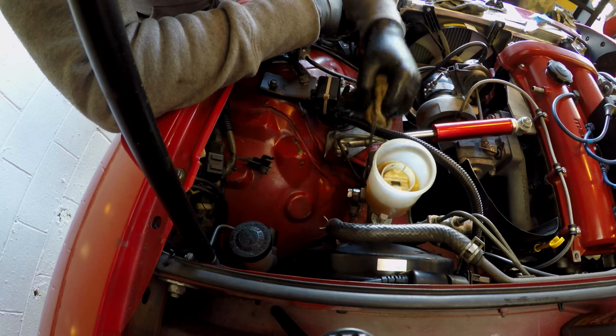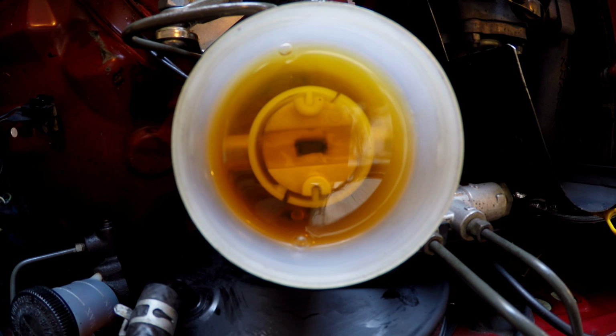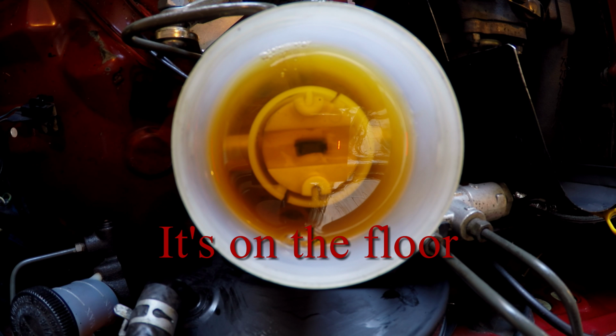All that's left now is to bleed the system. So what I want you to do is go ahead and like pump it a little bit 3 times. You holding it? All right. Keep holding it. It should fall to the floor. It did. Tell me when it fell all the way to the floor. All the way. All right. Pump it back up. Pump it 3 times. Okay. Now you're holding, right? It's on the floor.